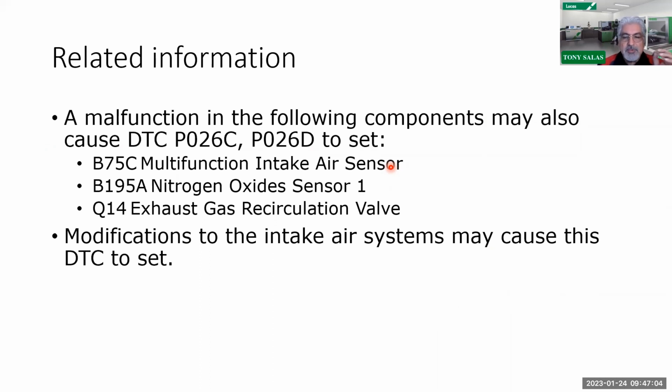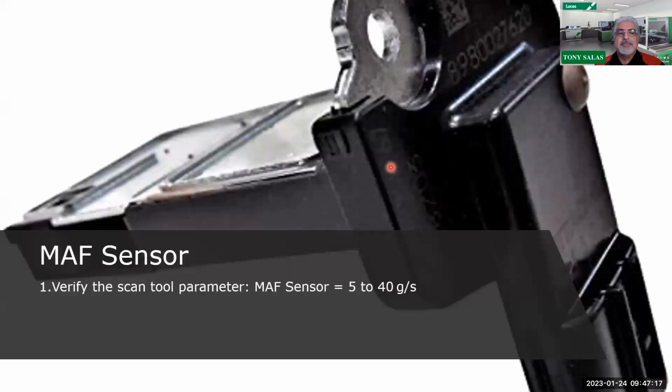Contamination. So we see nozzles where a certain spray pattern or just squirting directly, we can have issues with that. So a good cleaner can also alleviate that, because that can also be your problem in causing these various different codes to set. Okay, so keep that in mind.